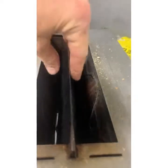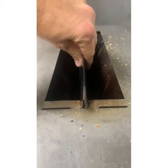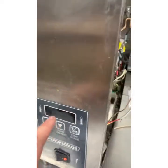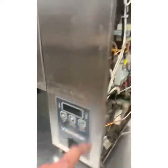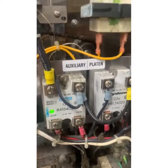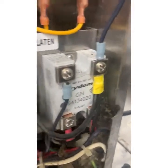The service manual tells you when it says 'hi,' it's the primary plate. The unit is heating the primary plate and the rollers — air temperature and plate temperature. The probe that runs to the plate temperature sensor, when it fails, says high temp. When that happens, the heaters keep running until it gets so hot that it shuts down.